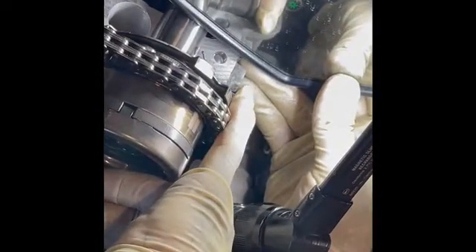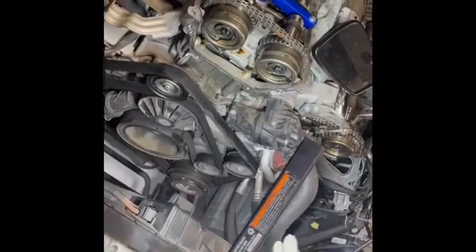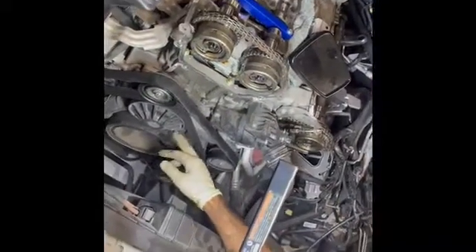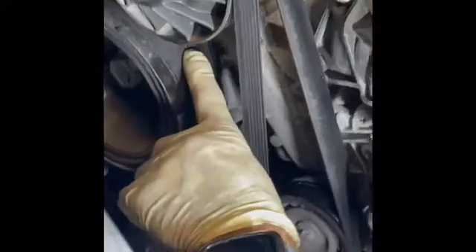This marking right here will be flush with the cylinder head on this side. So the way to check if the engine is timed — and the difference between M276, M57, M157, and M278 — is that if you rotate the engine to 53 degrees and align the 53-degree mark with this edge, then the plate on the back of the camshaft — the small ones — are going to be aligned.